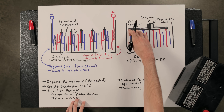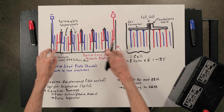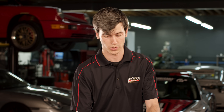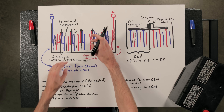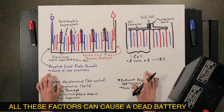Active material on the plates can fall off, and batteries have space at the bottom to allow that debris to collect. In severe vibration scenarios, the separator could be pierced and short out the circuit by connecting the positive and negative plates. These batteries are fine for most OEM applications, however some manufacturers are looking toward absorbed glass mat batteries for their added benefits.